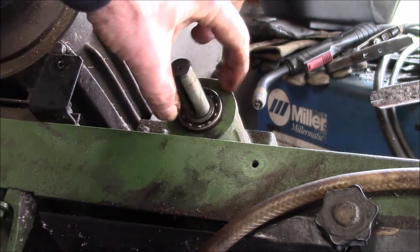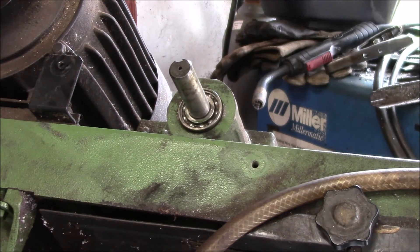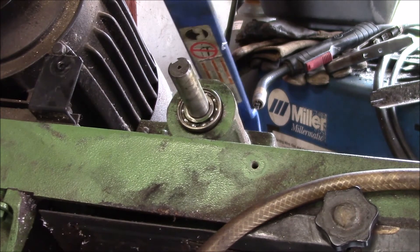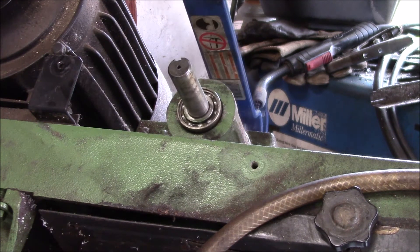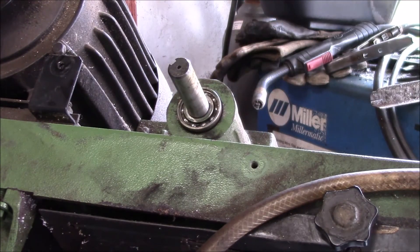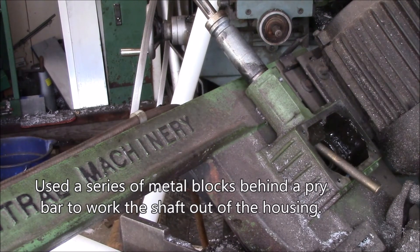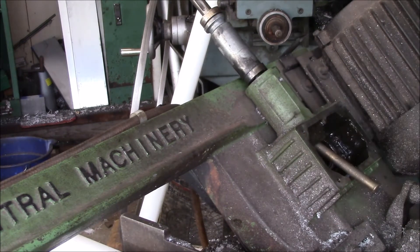One thing I notice is it's sticking out of the housing — it's not driven in all the way — and the outer race is loose inside the housing. I don't know if it's just not installed right. I'm just prying up on the bottom of the worm gear. Let me work on this a little bit more. I picked up my brass drift — I keep this in my truck toolbox for working on the cone washers on the front hubs — but I think this did the trick. There we go.